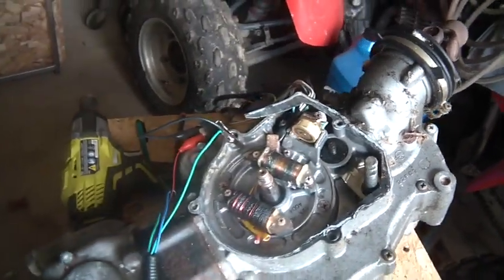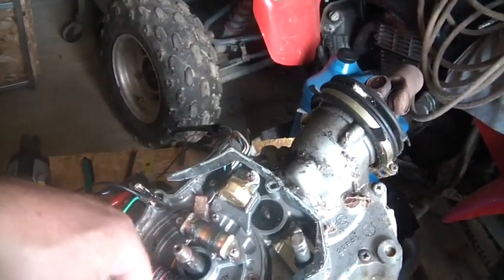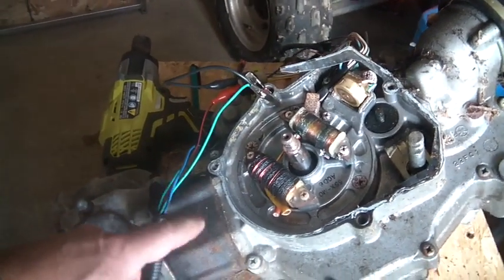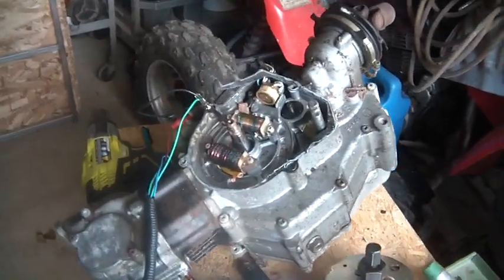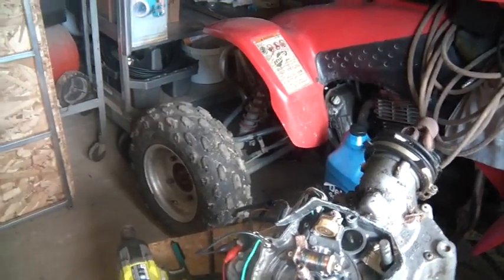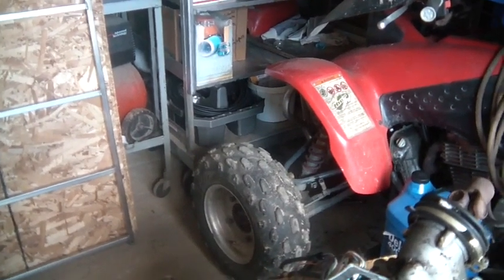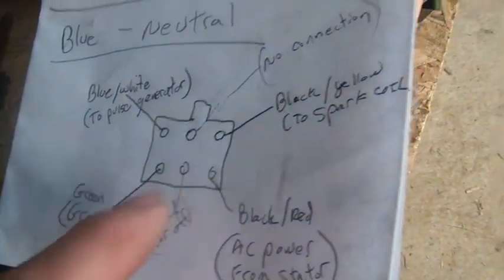What's wrong with this? I think it was over-revved or the oil wasn't changed frequently enough and the rod snapped — do take note of how careful I'm being with my words. The important thing: I always tell people you have to make your CDI happy or you will not get a spark. This is your standard CDI unit. We're talking about a pit bike, so it's an AC CDI unit.